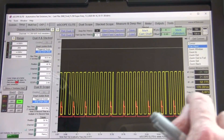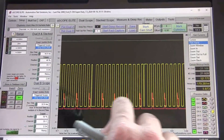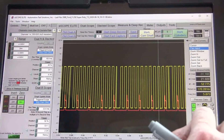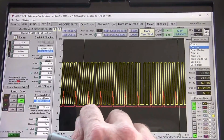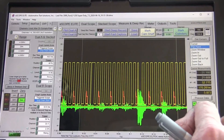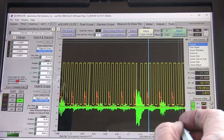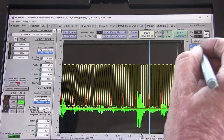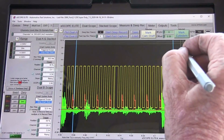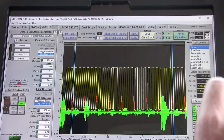So I want to go ahead and turn on our targets. We can see our targets in here — once again these guys are sitting in the valleys right where they should sit, and all of them are targeted. So now what we want to do is take our blue trace and turn it on. Now we want to get the cursors and take the cursor. We need to move the pan handle over here. So we've got fire cycle to fire cycle. We're going to get the cursor and come put it on the injector and on the injector. Let's shut this off so we can better target the front edge.